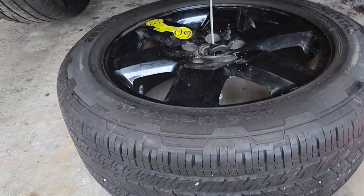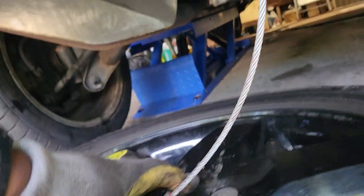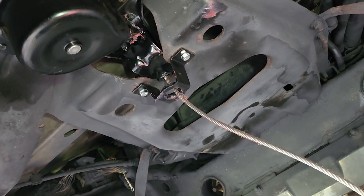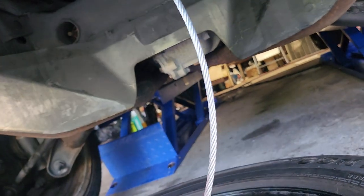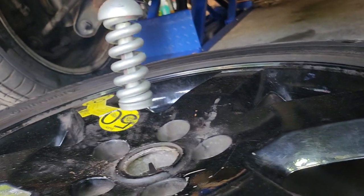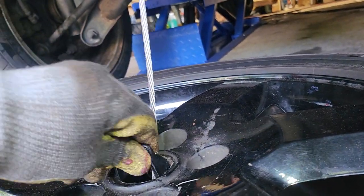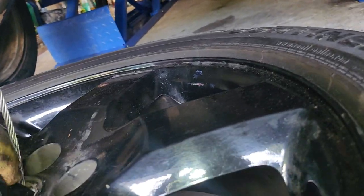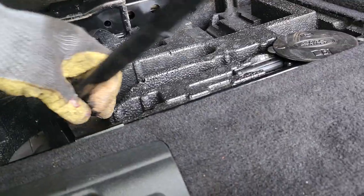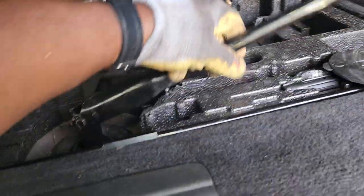To get it all set up, you've got to get the tire in there. What they recommend is to grease the cable so it works better. There's a lot of crud and rust that settles in and causes these hoists to go bad. To get the tire back in, you figure out the mechanism — the tire goes in one at a time, then this lever goes in. By the way, it is counterclockwise to lower the tire.